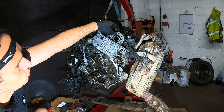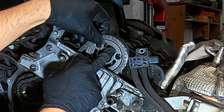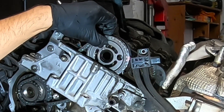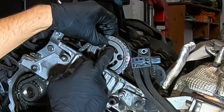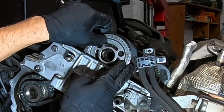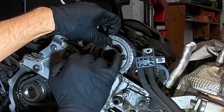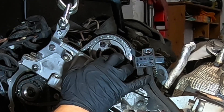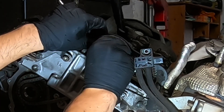So usually what I like to do here, I like to leave myself a good margin of setup. I'm trying to put this in the middle, so at the end when I'm putting the timing cover back and I have to slightly adjust the timing, I can loosen these three bolts and rotate it freely. You don't want to put it all the way to the maximum on this side — I'm trying to put it almost in the middle here. Although the timing is 100% spot on now, I'm still leaving myself some margin of adjustment.